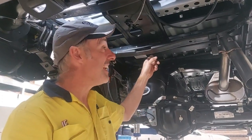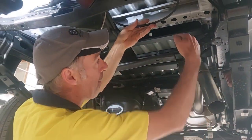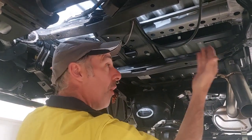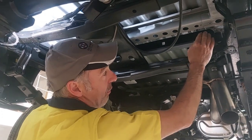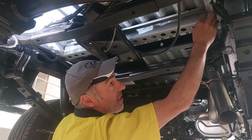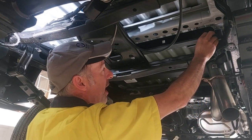The front rail is in. Now to put the rear rail in, the best way is up over this cross member — get it in and then roll it back into position. It goes outboard towards the rear of the two inner brackets. The rear rail has got some little 45-degree cuts off it on each corner to help with clearance from these tub mounts, so the rear rail is slightly different to the front rail.